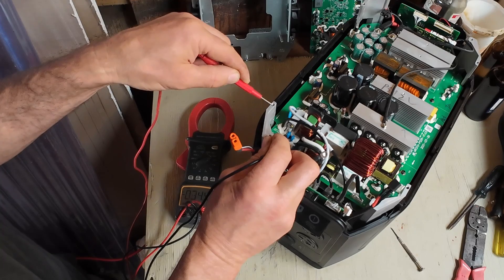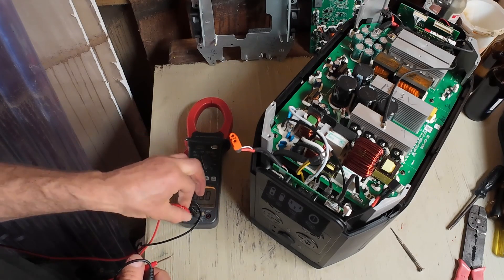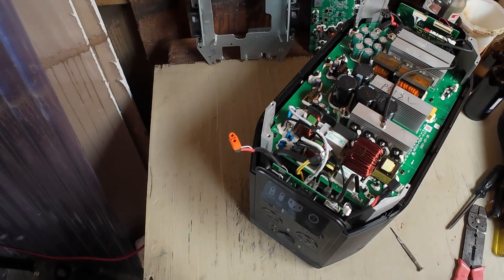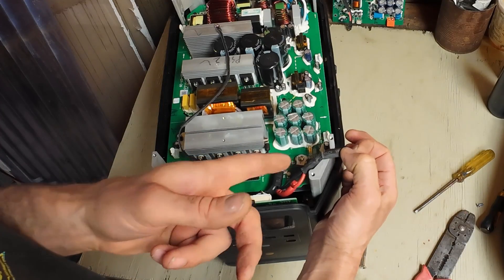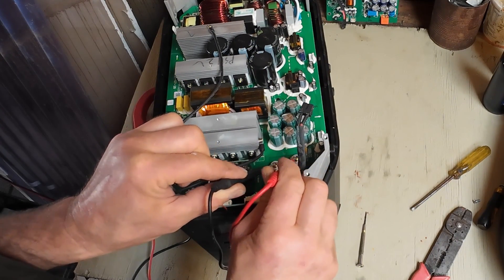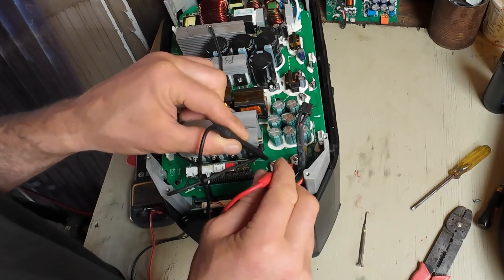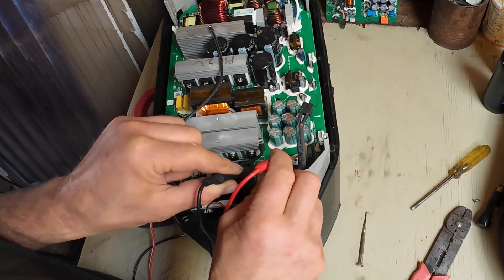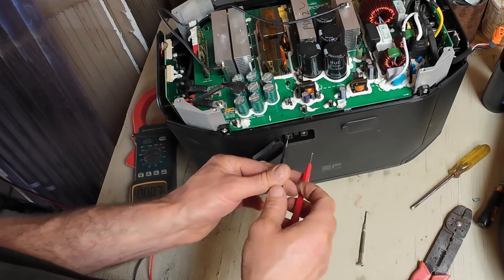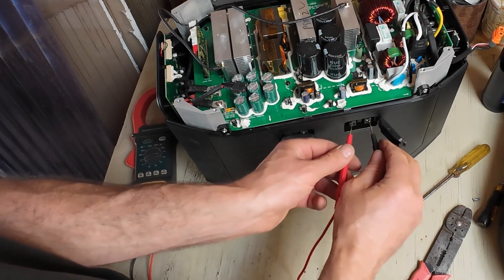Same on the other side, so I think that's okay. We'll test these terminals here and see if there's any juice in the battery. It's showing two volts there. There must be a relay further down that lets the power through, I'm guessing. This is the extra battery input — yeah, that's only saying one volt. There might be a relay there that the contact of it turns it on.